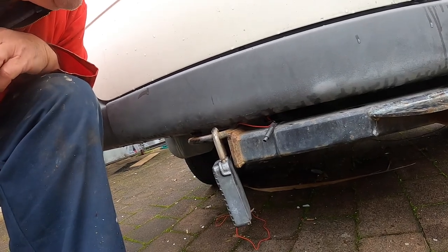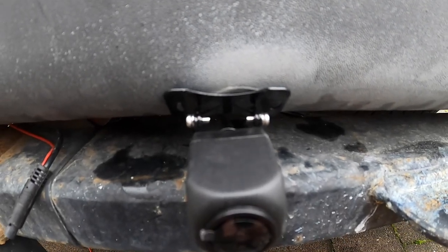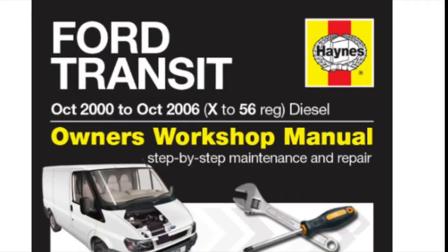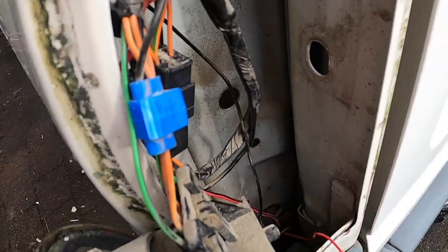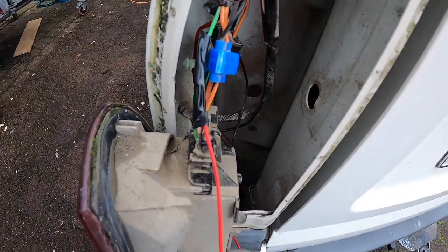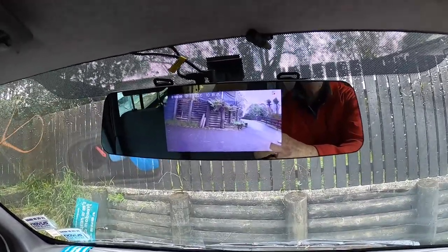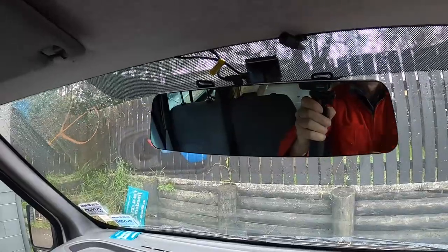Now it's just fixing the camera on and finding the power for the reversing light. It's stuck in place with some Butyl, because the 3M tape didn't want to stick to the bumper, and I've just got to put in a couple of screws. According to the Haynes Workshop manual, the green and black cable is the reversing light. So I need to connect my red wire in with that one and we should be all go. I spliced into that green and black cable with insulating tape. Before I put it all back together, I tested it — turned the ignition on, put the car into reverse, and we've got a reversing camera — it's working! Take it out of reverse and there it is gone.